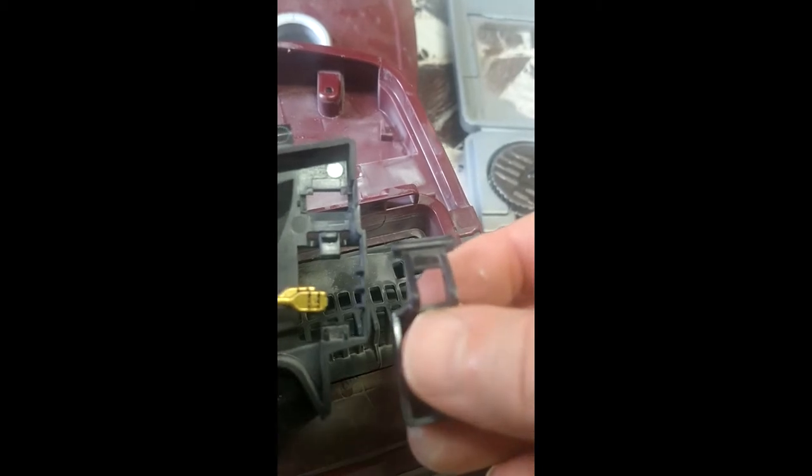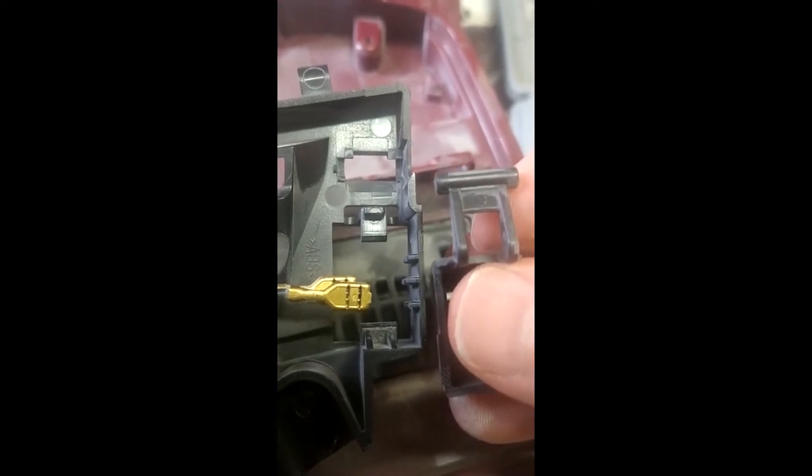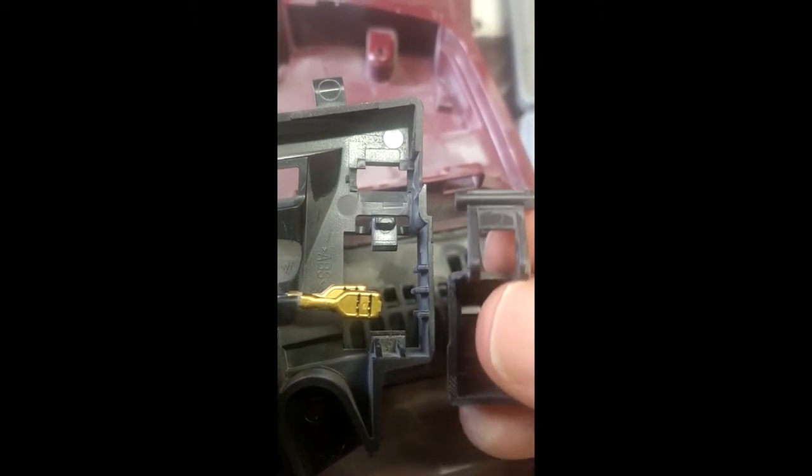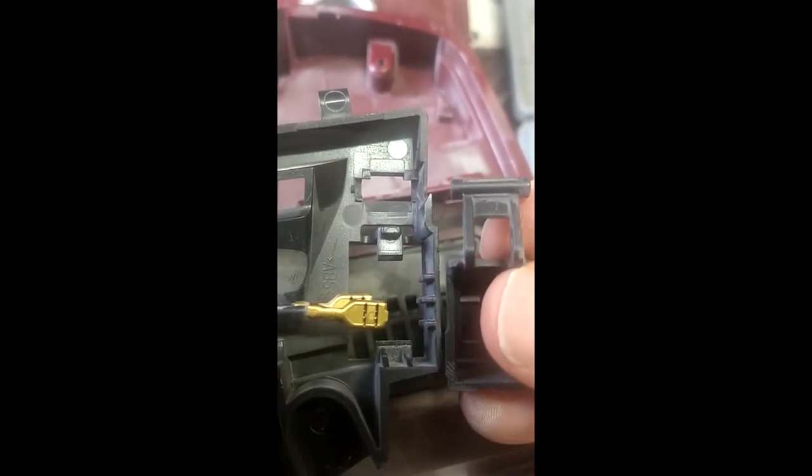You can see here where this plastic has gone white — there's one there and one there, and there's a slight dish indentation here and on that side. That allows this round section of the switch to sit in the dishes, and obviously those two small bits of plastic were there retaining this round section. So when you put your foot on the silver button on top, this rocks up and down, will depress the switch, the switch will latch closed, and then this will come up. But because those bits of plastic have broken off...